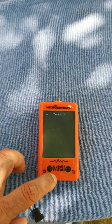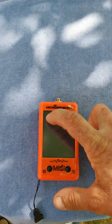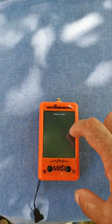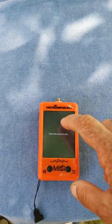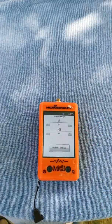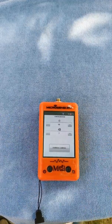In the configuration menu, if you want to calibrate your screen, make a long press to enter the configuration menu, then two brief presses on the left button to reach 'Touch to calibrate'. Touch the little cross as it moves from top-left to bottom-right. At the end it says 'Touch screen to exit'. You can then test your calibration by adjusting the volume to check everything is working fine.